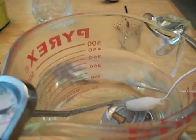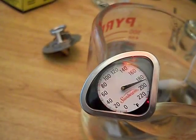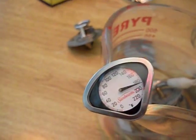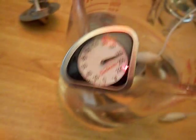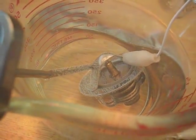Not even a smidgen of movement there. I'll heat it up again to see what temperature this thing finally opens at. At about 190 it opened up fully. So now I'm curious — does that mean it won't close again until it gets back down to 160? I'll just let this thing sit and keep an eye on it. I'm no expert on these things. It's supposed to open at 160 but it definitely opened at 190. I'll keep an eye on it and then try the cheap Stant later.